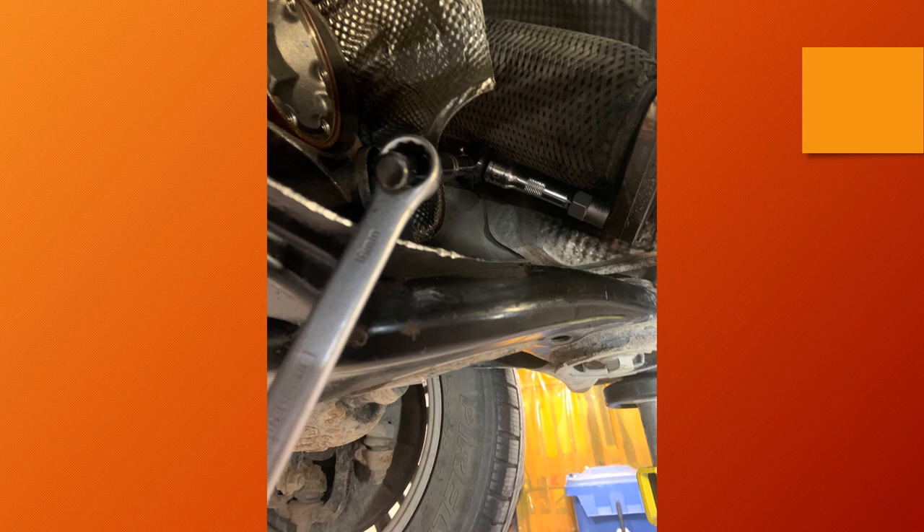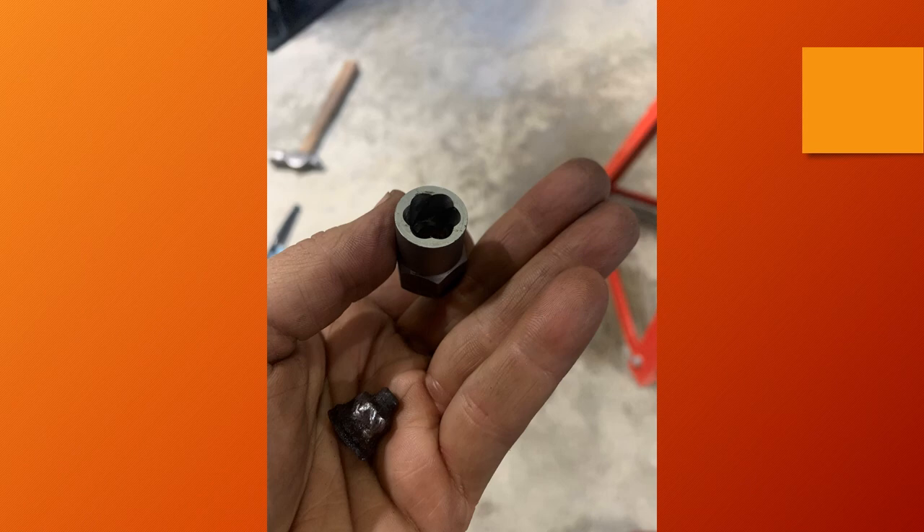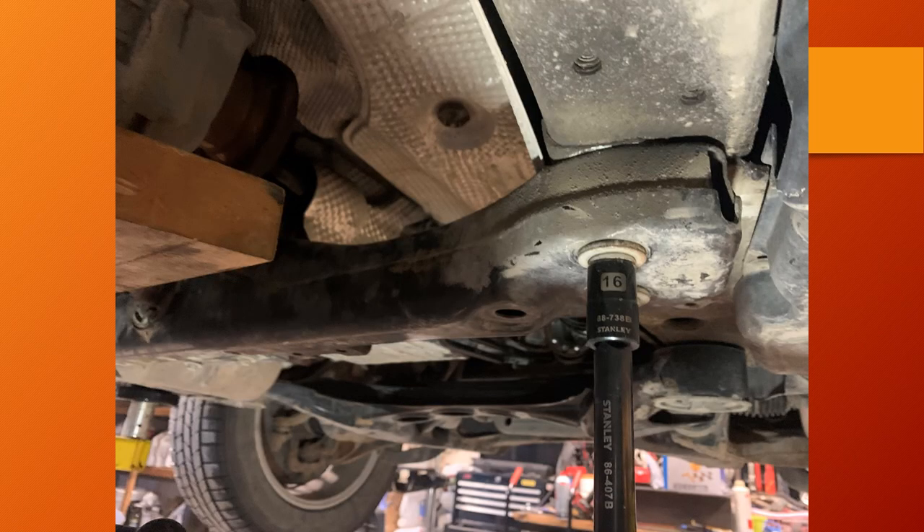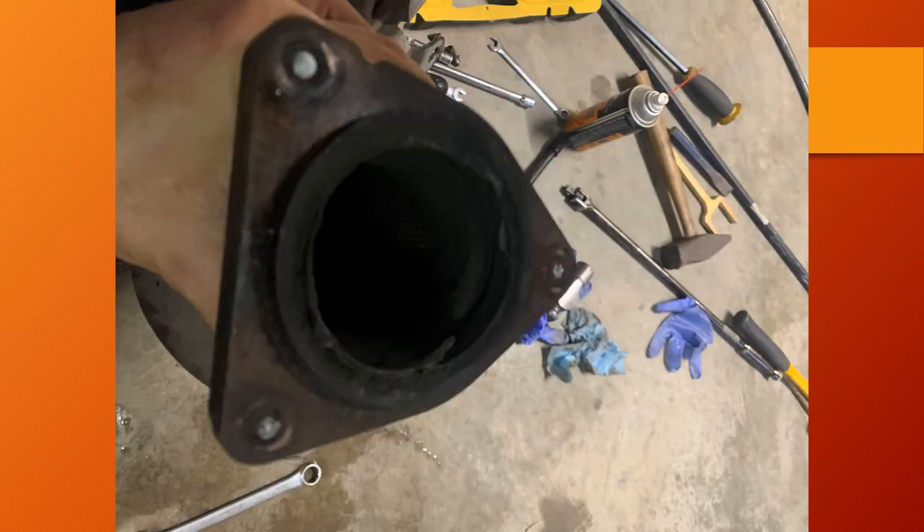The nut remover worked really well to grip the nuts, and the nuts just ended up snapping off — the nut with stud just snapped off without much effort, so that's kind of an expectation for this job if it's never been off the car before. The reason I was replacing the primary catalytic converter is because there was an exhaust leak. With the main catalytic converter disconnected from the primary cat and removed, it's a good idea at this time to temporarily reinstall the transmission crossmember using old hardware. The flange for the primary catalytic converter stayed connected to the main catalytic converter flange because the leak was so bad at the flex pipe that it just disintegrated with movement.